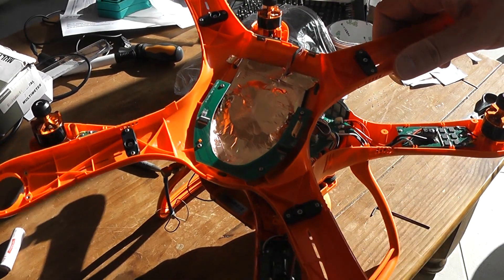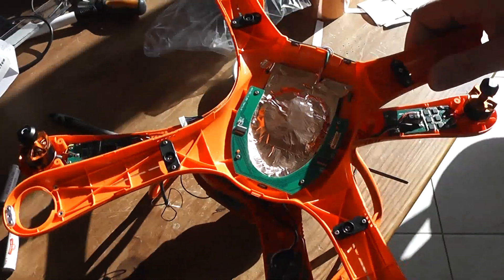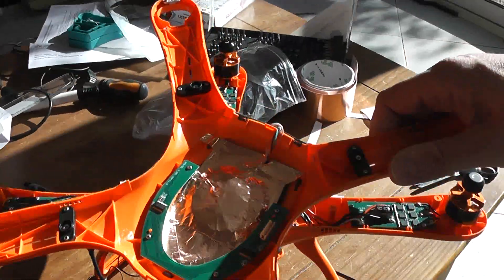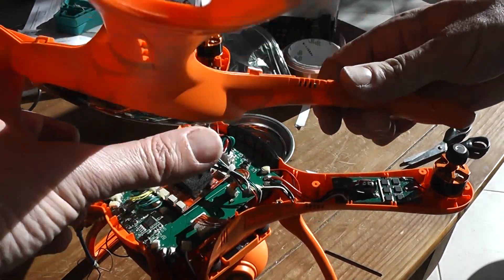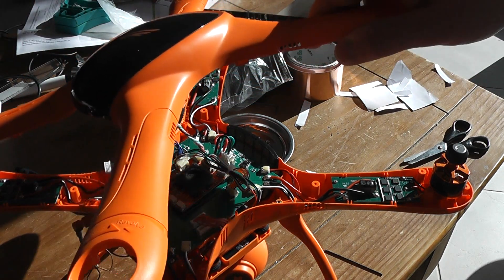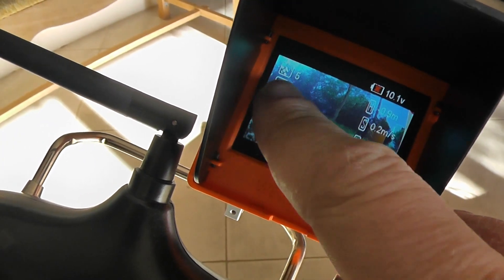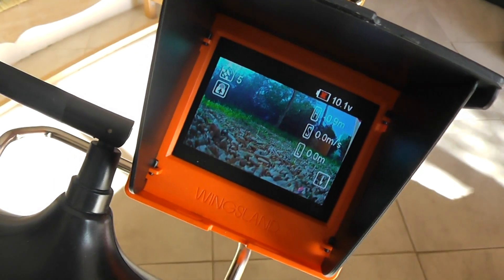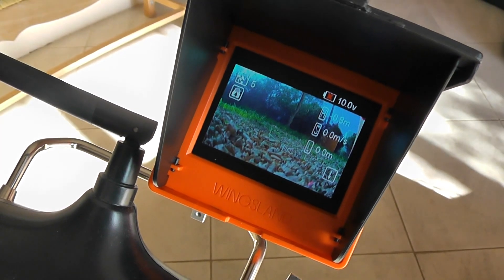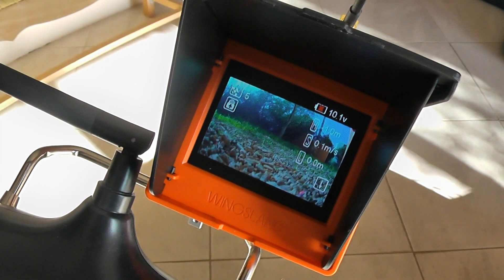Here is the result of the EMI taping. As you can see, it's well protected — I installed the EMI paper twice on the main structure for full protection. Now reassemble everything, making sure to reattach the GPS connector. Before screwing everything back, verify you're receiving satellites — I'm receiving up to five satellites outdoors. Then screw it up to confirm you haven't missed anything. Thank you for watching, hope you improve your GPS positioning.